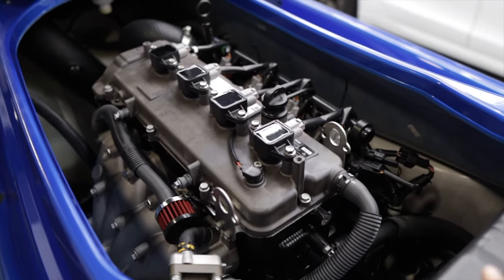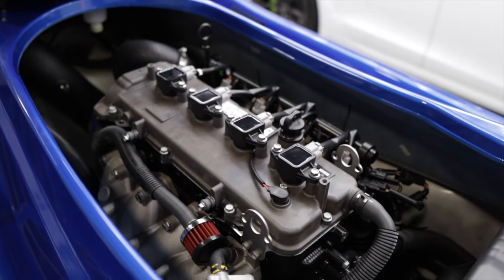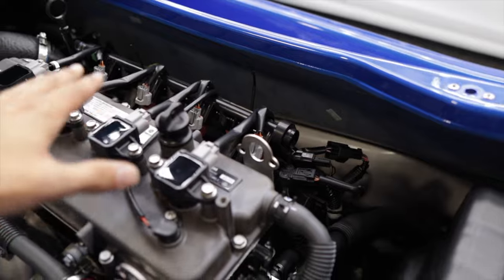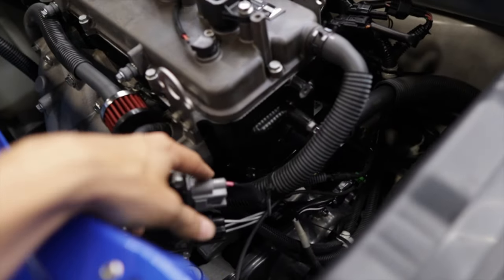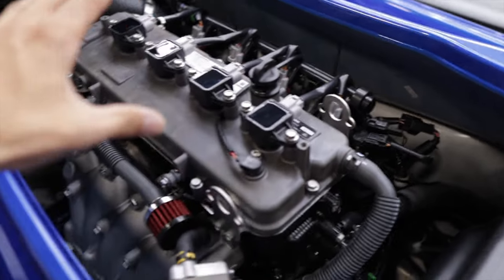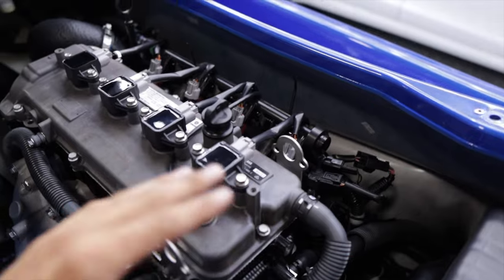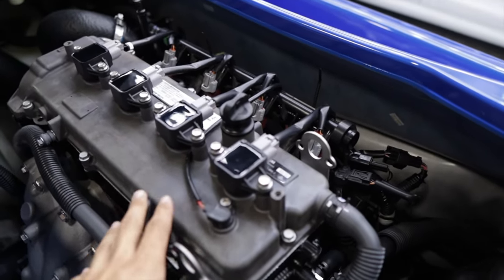You can see the engine is completely assembled. I do have the engine cover off and the plastic deck that sits below the seat off already. To begin this, you're going to want to start stripping all the wiring off of the intake manifold and on the exhaust. From there you'll have to remove the intake manifold and the exhaust manifold, and a 12 millimeter is going to be your friend because that's what the bolts are. That's really all there is to it stripping that down off the engine.